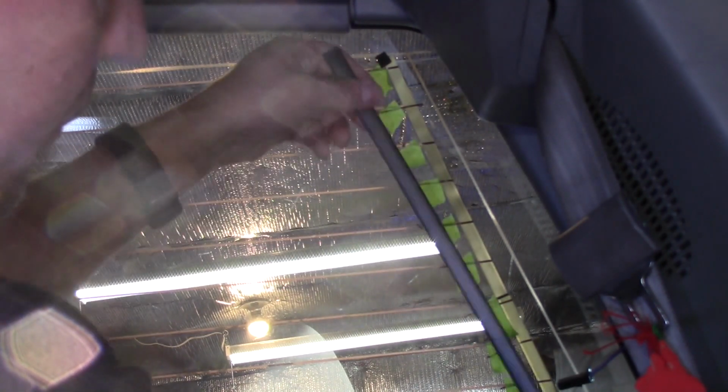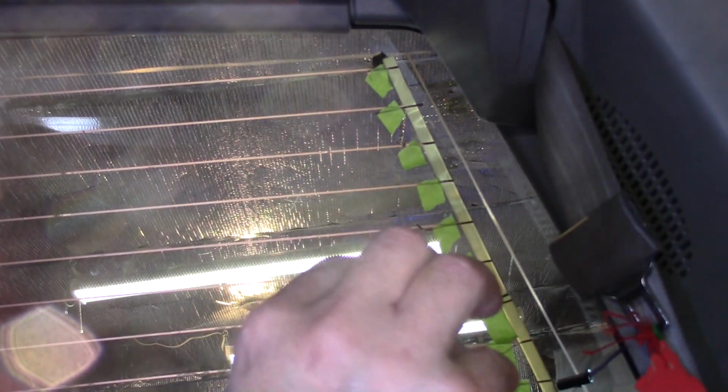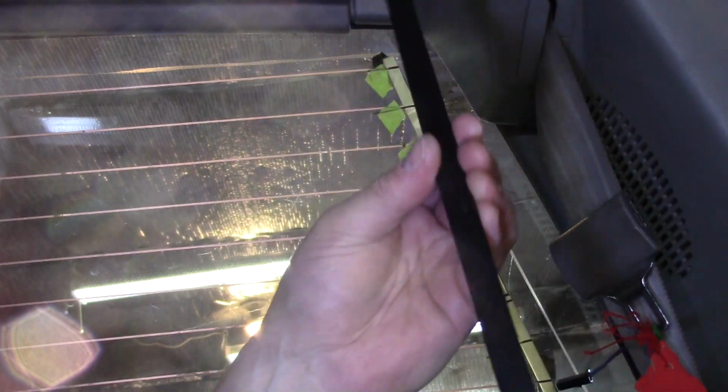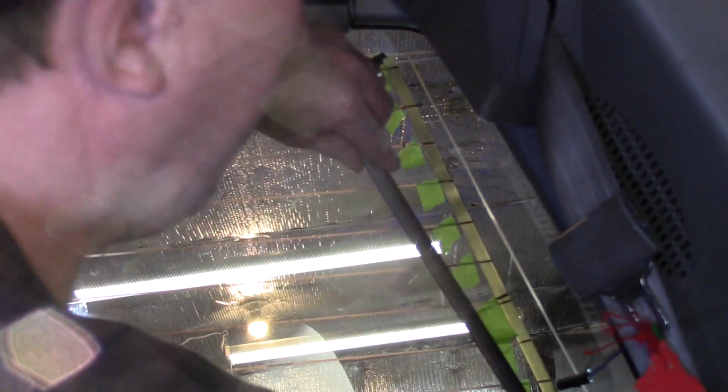Alright, now we're going to take this one and put it over it like this. Okay, so we peel the adhesive back off this. I can tell you that 3M adhesive is sticky too, holy smokes. Alright, so pay attention, you've got a little slot for your connection or your tab for your bus, the shorter bus. Now on the other side, the shorter bus has to be on the top, or vice versa, right?